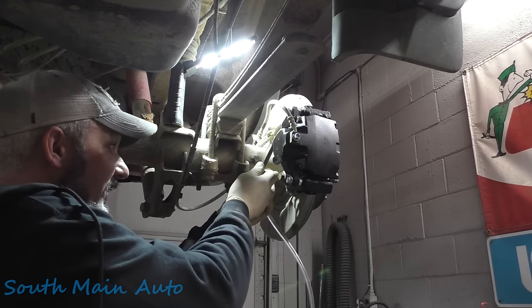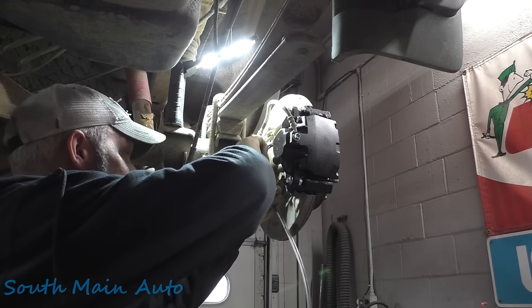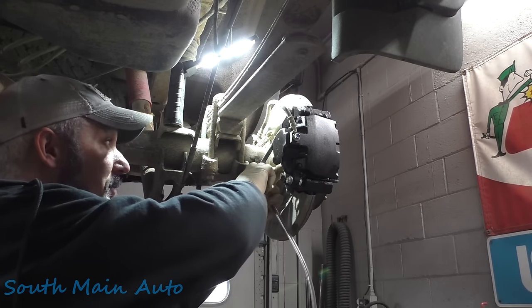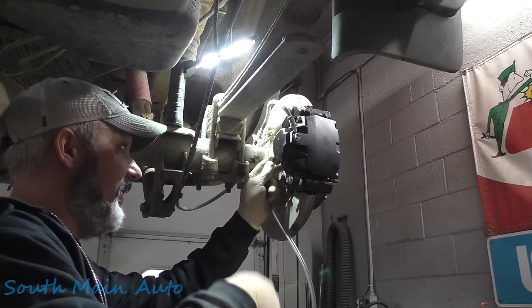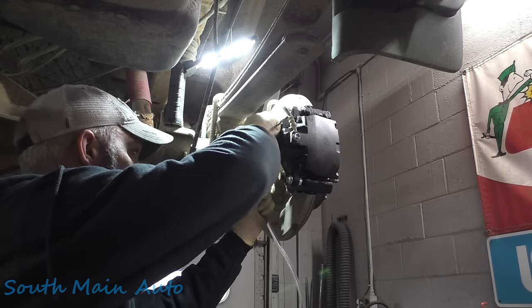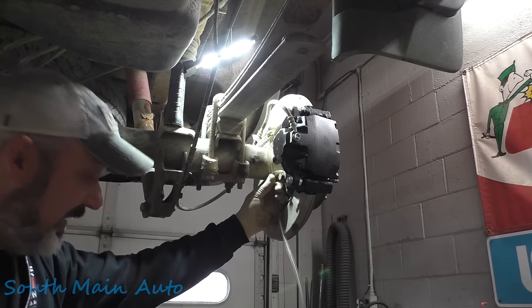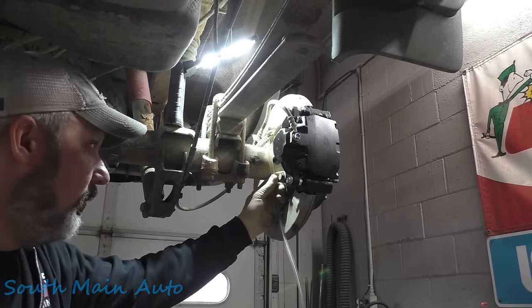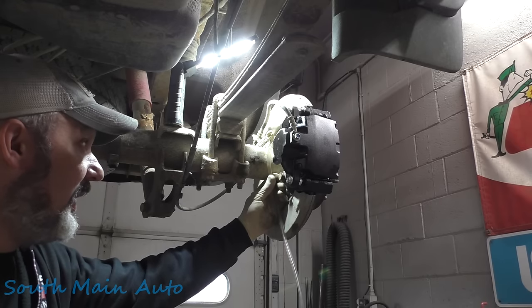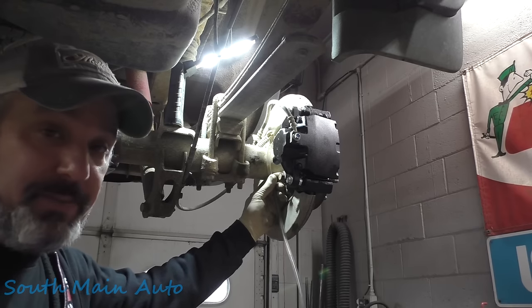If you do have a Chevrolet and you blow your brake line and you did drive it home and you ran it out of fluid and the master cylinder's got air and the ABS valve has air in it, just bleed them conventionally. Get your buddy up in there, push on the brake, open the bleeder, get them bleeding good. When it looks like you have good flow, your pedal's still spongy, you can't figure out why, take it out just on some wet grass or anything slippery and do a couple ABS stops with it.